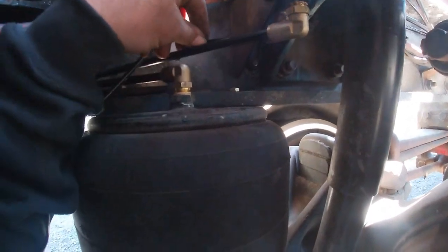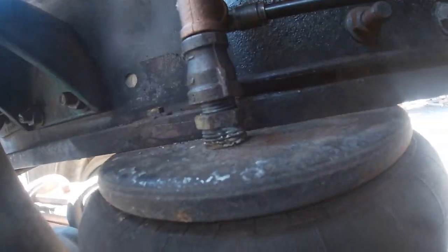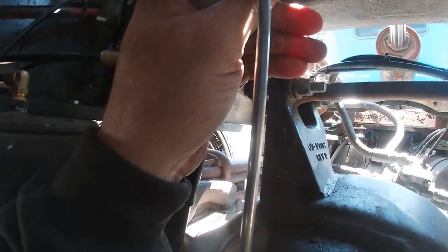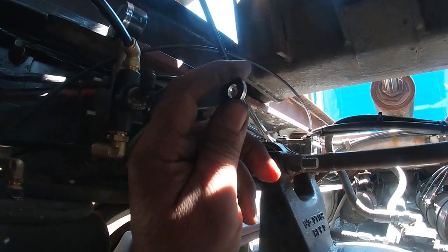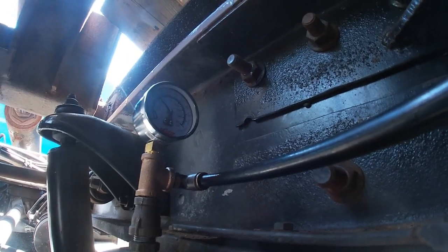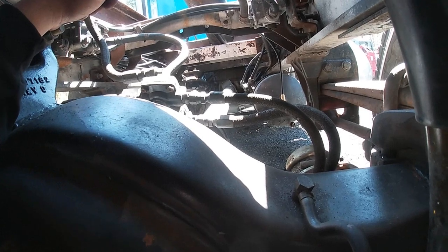The problem I think is fixed, because the last time air was leaking from the drain line — the valve itself wouldn't stop leaking. I fixed that problem; the valve doesn't leak anymore. But now I've got another problem over here. I took the rod off to show you manually how this works. When the rod is connected and you push it up, it'll put more air in the truck — you can see the bags extended pretty well. Still 40 pounds in the bags. However, that will change your driveline angle, although that driveline angle isn't that bad to be honest.